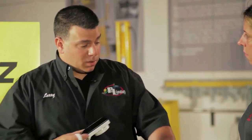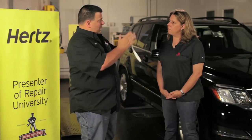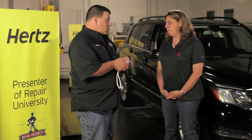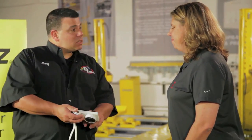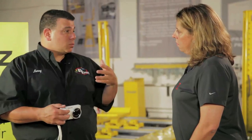Once you're done with overall pictures, start attacking your damage. If the vehicle has damage to the bumper cover, headlight, fender, and door, start just like you'd write your estimate — start with the bumper cover. A big mistake is taking the picture of the bumper cover from a high angled-down position. You're not getting a full view. The best thing is to bend down into a catcher's position or hold the camera low, so the camera is looking level — like your eyes would — so you can tell the story.